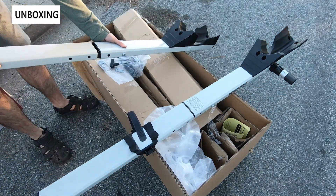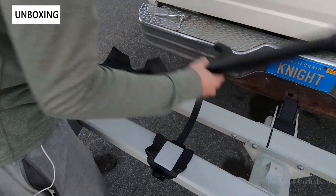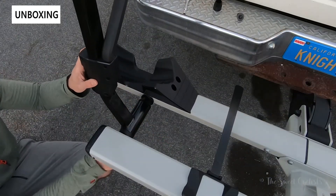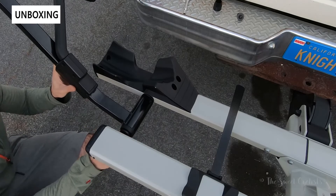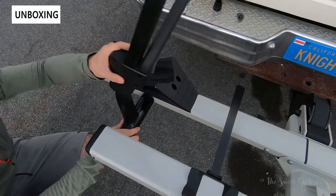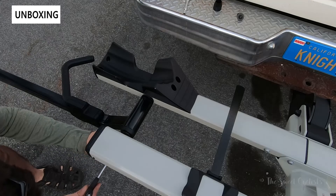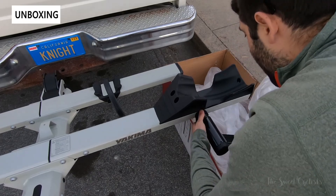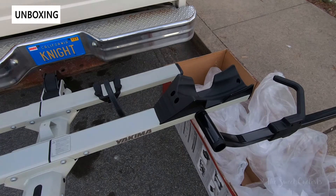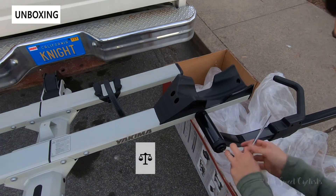Putting the rack together is pretty straightforward. There are only a few steps: you want to put the main spine portion through the hitch, install each of the trays and use about four bolts each, then you have the pivoting arms which push down on the front wheels and need to be bolted in place. No torque wrench is included, so you'll need your own for correct torque measurements, otherwise you can use the provided six millimeter allen key. Once you have each pivot arm installed, tighten them enough to get through the thread lock but not so tight that it won't rotate. It's a tiered system so the rear one is a little bit higher, and you just tighten everything down to feel nice and snug without any side to side motion.